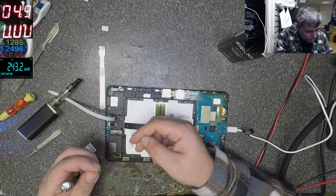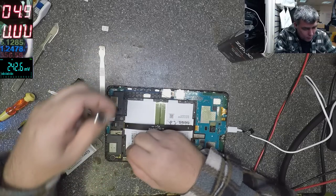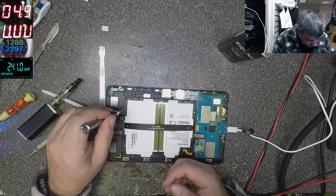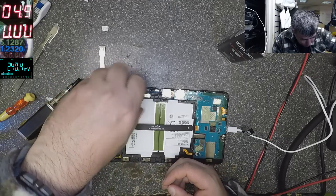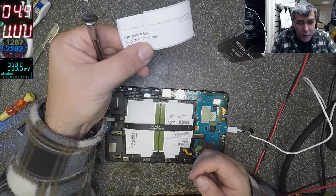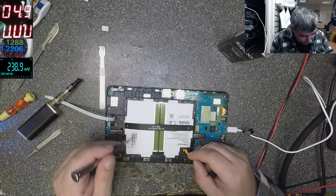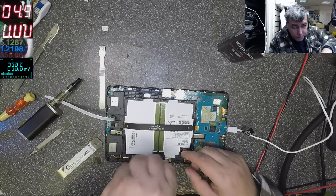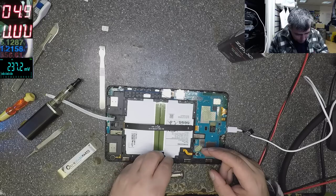This tablet, I can bet it's expensive. It's very easy to say, there's no picture, so probably it's the screen and things like that. Very easy to say, but it's not always. Like in this case. This tablet was booked in for testing, so obviously the man tried himself. Tried different chargers, and it's not that. And it's not displaying. It is charging at 1.2 amps. If you move the charging port and it's not charging, that's the second issue, and it has nothing to do with our problem.